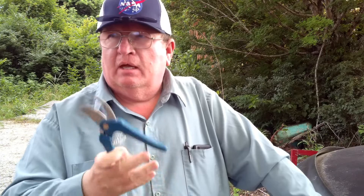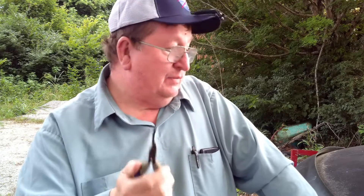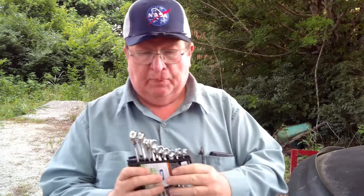I like to use these loppers for cutting that plastic fuel line — they do such a great job, just one little snip and done. You can use your pocket knife if you don't have a set of these. And then a little bitty tiny set of needle nose pliers, because there are some little bitty things you need to take loose from the carburetor. You can probably get away without them if your fingers are nimble, but my old fat fingers aren't. Finally, a set of metric box end wrenches. That's all the tools required to change a carburetor on this Craftsman riding mower.